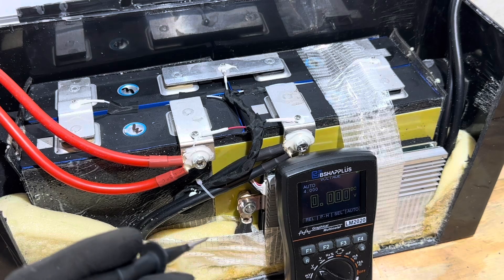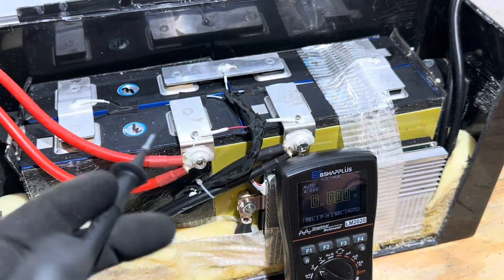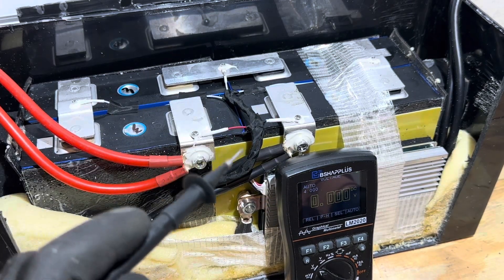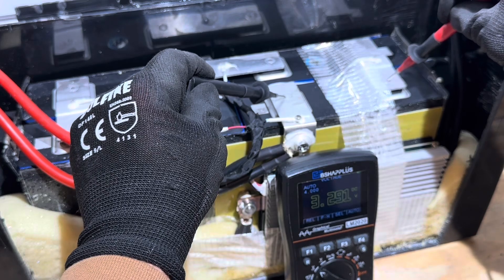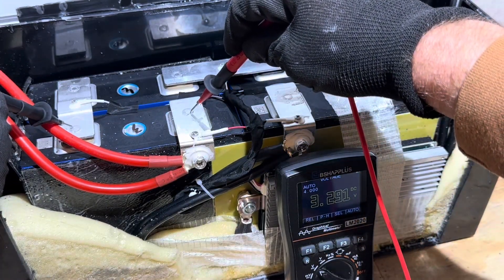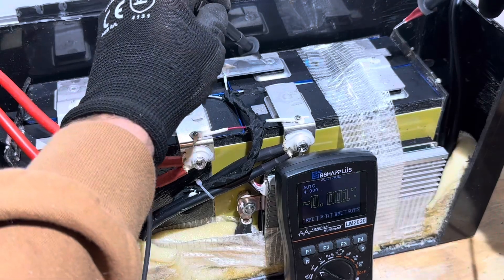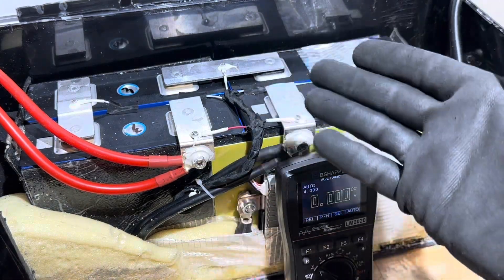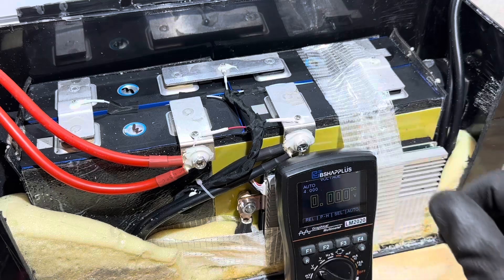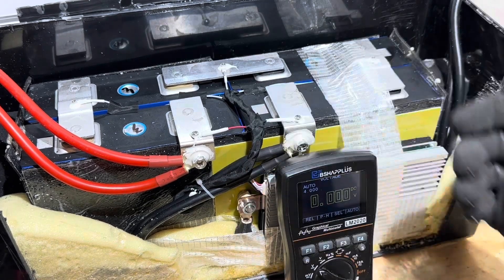After the pull-down, I charged this battery back up partially. I want to check if the cells are balanced and well-matched — because if you remember that other battery from a while back, the cells were all over the place. Let's check this Aokley and see how balanced the cells are after partially charging back up. Cell one: 3.291 volts. Cell two: 3.291. Cell three back here: 3.291. And then the final cell: 3.291. A very balanced and well-matched cell group in this battery — that's a very good voltage gradient, basically nothing between the cells. Very well-matched; I like seeing that.